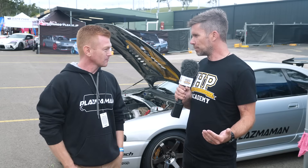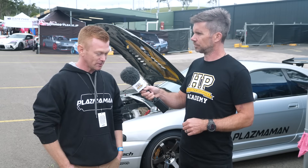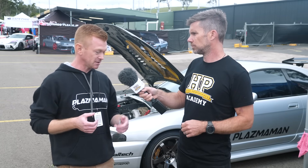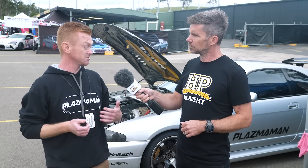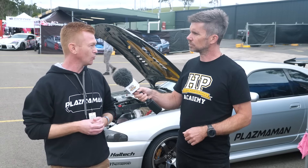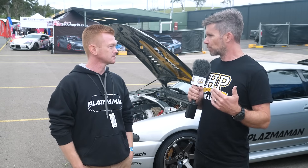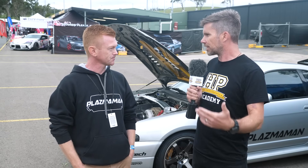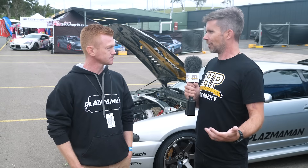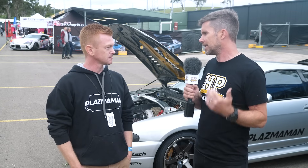I've actually seen a 90mm LS throttle body make 2,200 horsepower at the tyres. So those people who think they need a 90mm throttle body on their street-driven 4G63 are not in the ballpark. Basically, try not to over throttle body things — measure the pressure drop in the inlet and before the intercooler pipe, and see the difference. If it's more than about 4 psi, then it's probably worthwhile changing. It's a common misconception to assume a larger throttle body is a must-have without actually testing if the restriction exists, and there are real downsides to going too large.